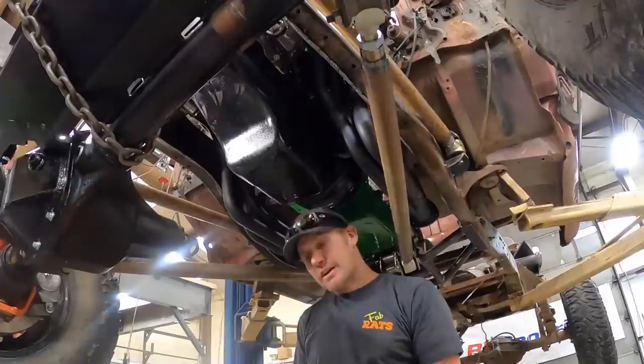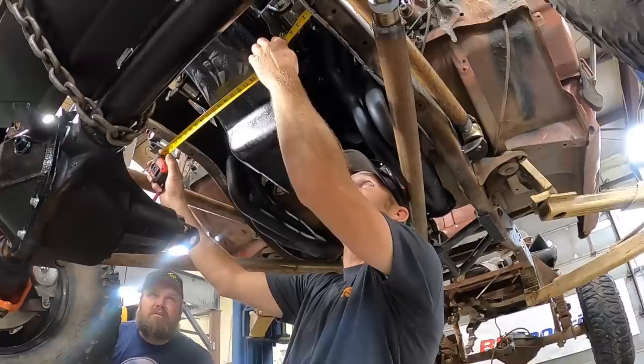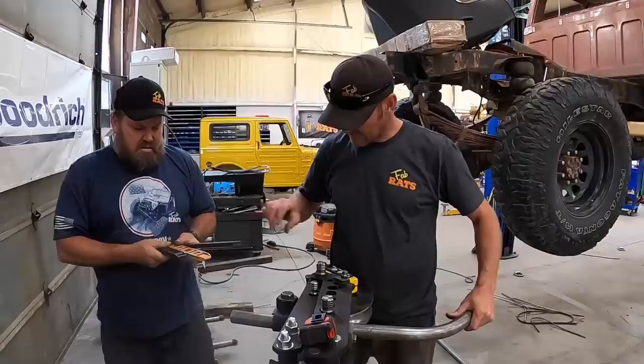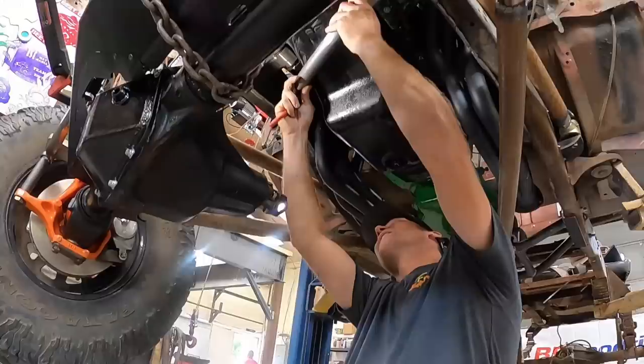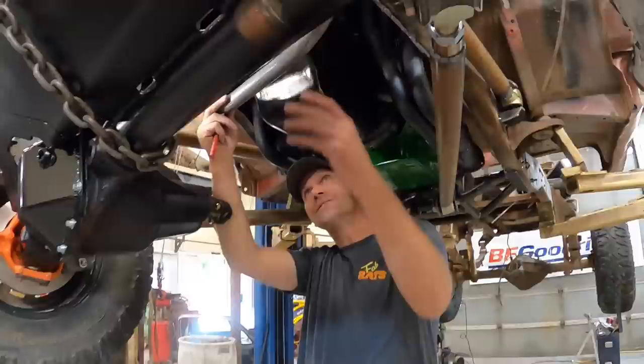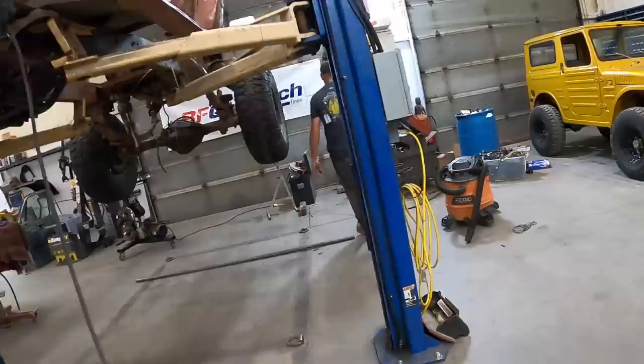29 inches. Okay, we're gonna do this. I calculate the center of my bend needs to be at 8 inches, which means at like 7 inches, I need to start bending it. There's ya. Oh, it's close. Look at you. Yep, now we just gotta cut it off the same as this other side, and it should go right in the frame. Zip-a-dee-doo-dah. That's gonna fit perfect right there. I'll do a little cutting, these ears off so it fits right. Voila!